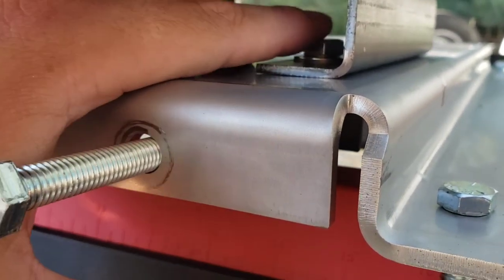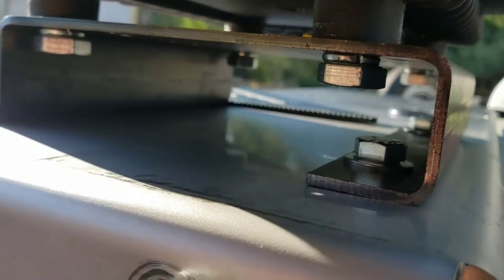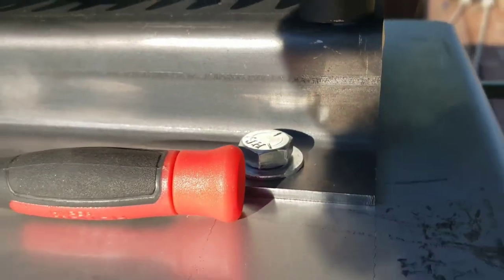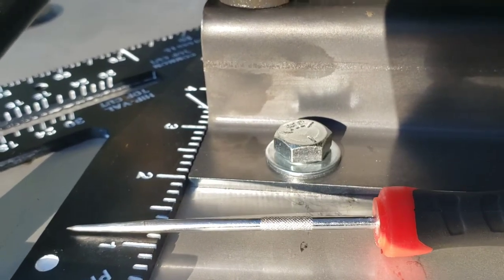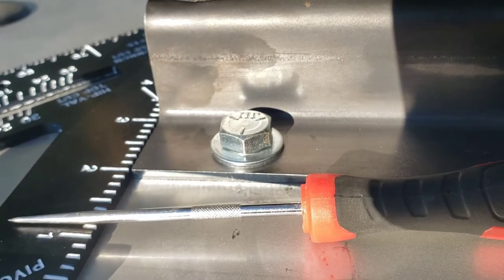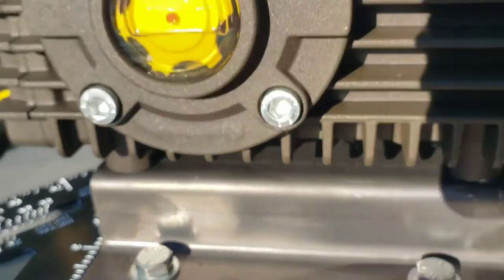I had put the pump on, and then I wiggled the bolts in place on both sides over here. Here they're exposed, so it's much easier. And what I did was, I just tightened them where there's just the slightest of play. This one's going to be easier to get to. You hear that little noise? I can rotate it by hand. Just the slightest of play. It's not a tilt, it's more of a back and forth, left and right. That's about as tight as you're going to want to get it, so that it moves freely back and forth.